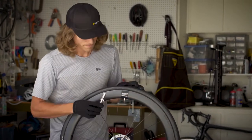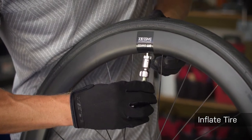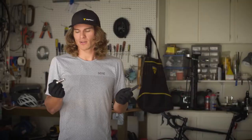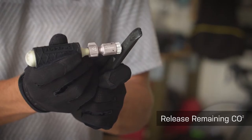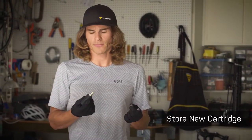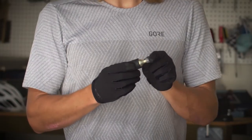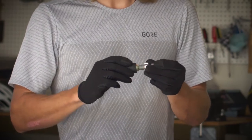While only holding the silicone sleeve, inflate your tire. When finished inflating, make sure to expend all the extra CO2 within the canister before heading out for your next ride. To store a fresh CO2 canister, place the safety spacer onto the threads of the canister and attach your Micro Air Booster so that you're in storage mode.